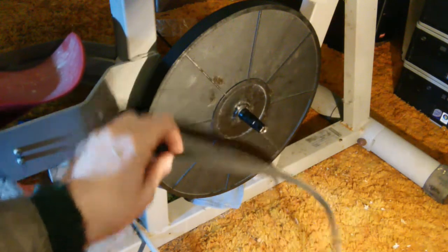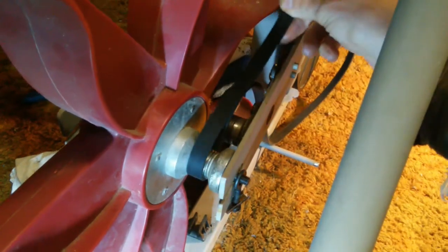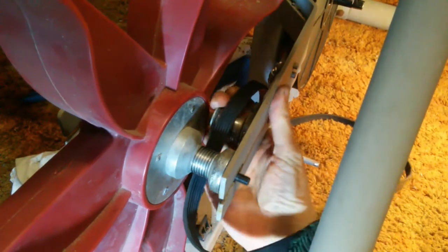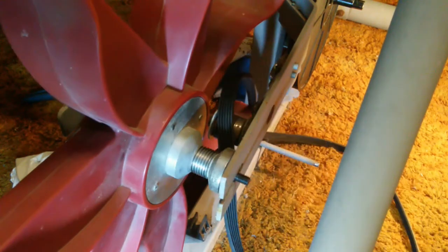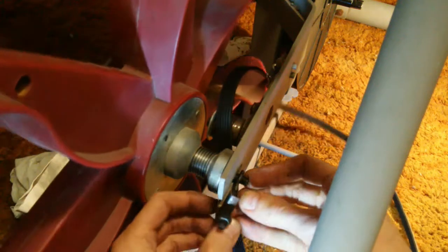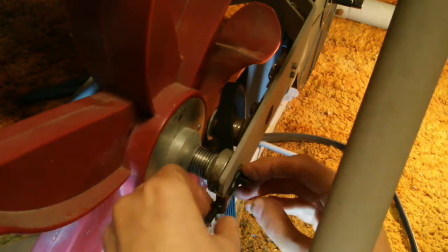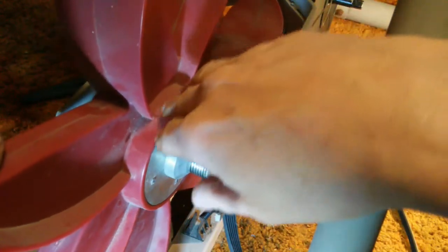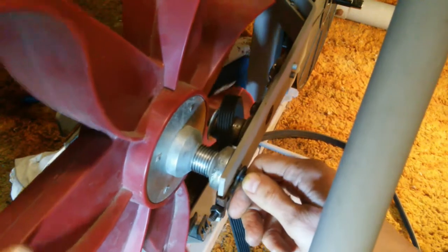We have to look at the fan first. The belt wraps around over the fan. In here we have a tensioner or idler with a spring providing tension — it's not adjustable. The way we adjust tension is with these little adjusters. One end goes around the fan axle and the other slotted end fits in here with a nut. This screw will move the entire fan forward and put tension on the belt. Adjust these all the way out so the fan goes as far in as possible — that gives minimum tension — and once the belt is on, then you can tighten them.